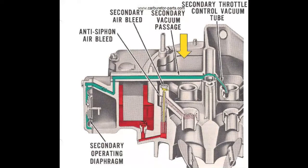There's a diaphragm and there's a spring in front of it. The vacuum helps the diaphragm open up the secondary throttle plates. Also, there is some mechanical linkage that also goes along with it. This is your main jet, so while all this is happening you've got fuel flowing in here due to vacuum in your secondary. When your throttle valves open in the secondary, it creates vacuum in here and it pulls fuel up through your main jet into the secondary, and it mixes with air from these secondary air bleeds that are on top.